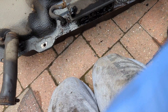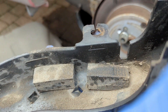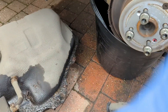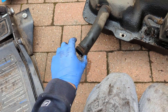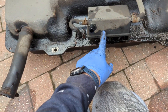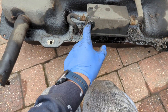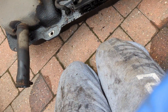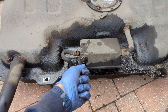There's a piece of plastic underneath the car that just clips in, with one nut — I think 14mm — holding it in. Removing that gives you a bit more access to get your hands around the pipes. Once you've released that nut, it's a bit of a wiggle because you need to be careful not to crack the plastic tube where the rubber pipe connects into it. There's also another unit here — I'm not sure what it does, possibly a breather. There are clips, a bit corroded, but decent pliers will release the bracket and the tube pulls off easily.